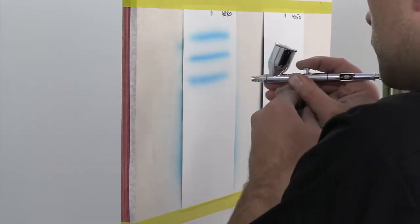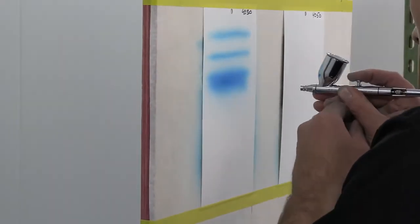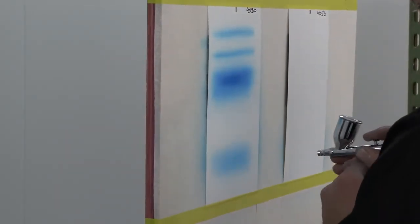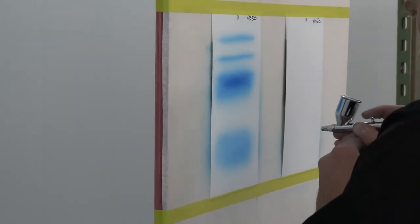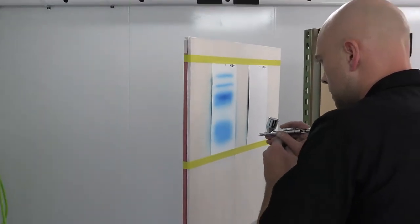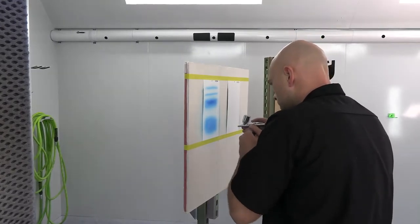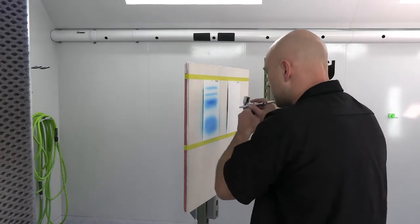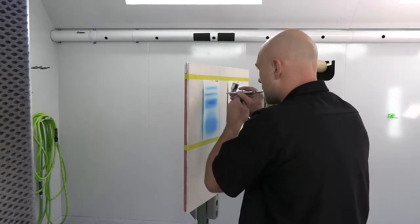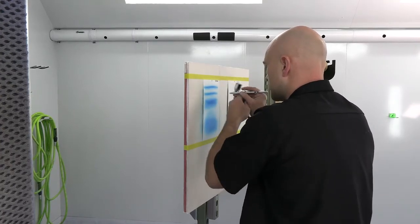Again, the whole deal with the candy is being able to work in light coats and gradually build up your color. So for the airbrush, the 40-30 is great. The only real difference is once we go into the big gun, it's a more dramatic difference. You can see I can build color nice, I can get a nice fade, it's gradual, and it dries pretty fast, which is what the 40-30 was initially designed for, as the carrier for this Candy2o system.